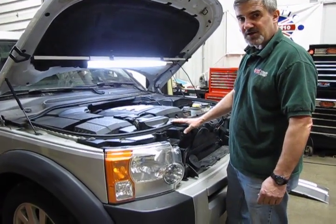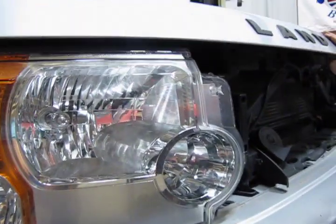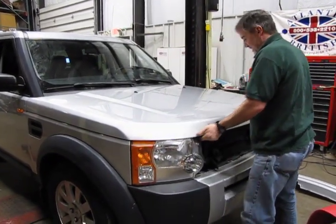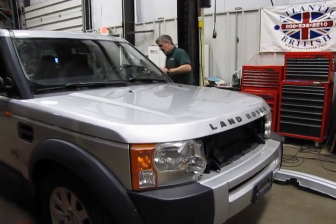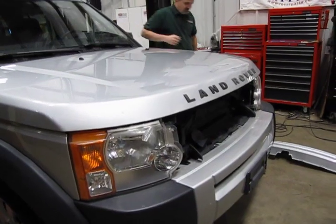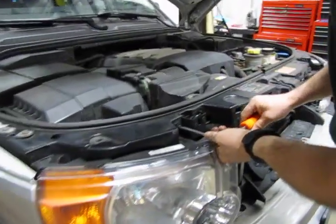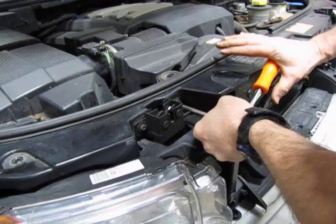We're going to move our light and do a test fit. With the grille out you can watch the loop — what they call the striker — up under the hood, and lower it down. Ideally you want it to hit dead center in the opening in the latch, which looks like we're pretty good there. The latch latched, and we didn't feel any hard rub, knock, or banging, so we know we're aligned pretty well. Make sure we release. That looked pretty good, so we're going to lock these down. It doesn't have to be real tight, just a good snug fit because you don't want them backing off.